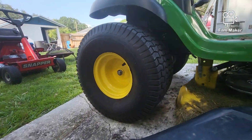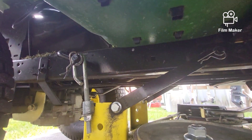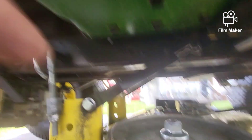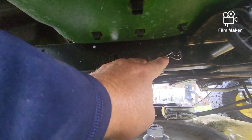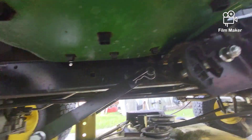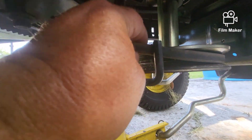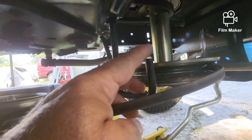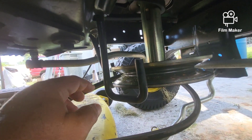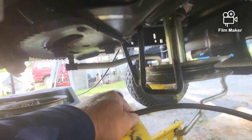So let me get you back in the stand. The first thing we're going to do is remove this deck. For those of you that tuned in to see how to remove a deck, it's real simple. Right here you have a pin that needs to come out — there's a washer behind it, you take that out. Also on your bracket here there's another pin — take that out, don't lose the washer, put it back where you found it. That is the stabilizer arm. Then on the front here, you have to get this belt out of this keeper. Just like that — and if it's too tight, which it shouldn't be touching, you can usually just pull that back with your finger and get that belt out. Take it off the front. There's also a keeper on the other side, we'll do the same thing. Now our belt is out — this is our deck belt.